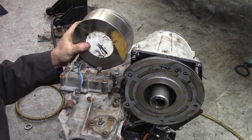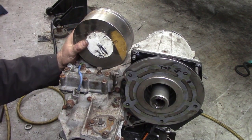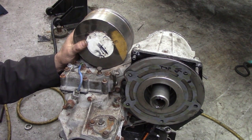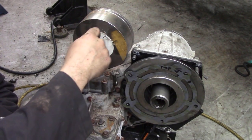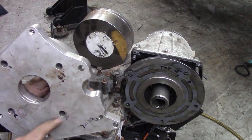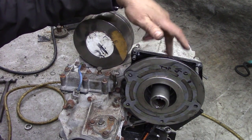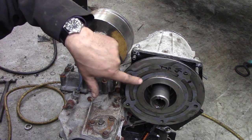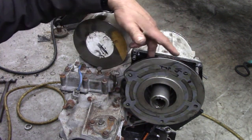We bought this great big piece of solid steel. We could have maybe got away with a bit of tube, but there was a lot of machining on this. What we did was we turned this piece down and put a boss on it which would fit through here to keep it concentric. The middle piece was turned to fit in the boss and also turned to fit this ring, so it would slip over the top, and then I welded them together.